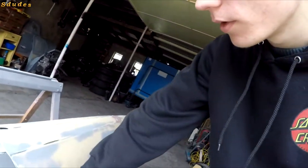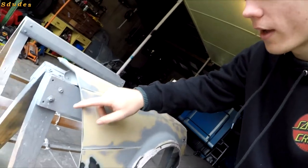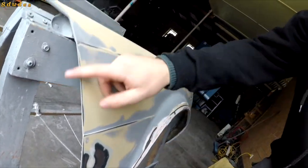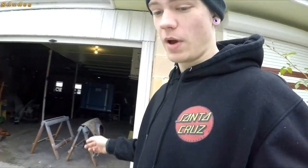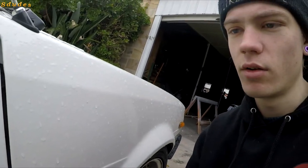One important thing: when you're doing the edges, make sure you get them all back to bare metal. If you have too many layers of paint built up — especially in the door jams — when you open the doors there's so much build-up it can crack. So I sand it back to bare metal and start from scratch.